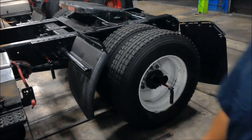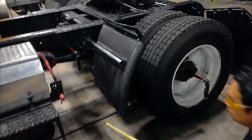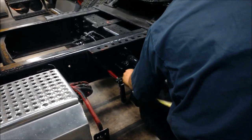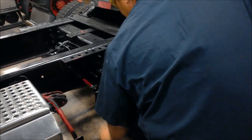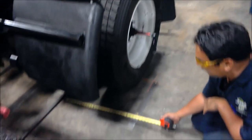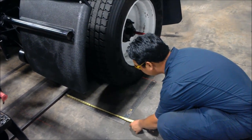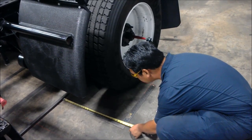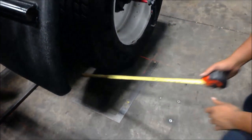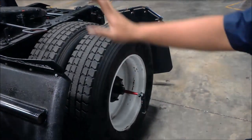I have the EZ line set up to where you can measure the offset of the wheels. I have it attached to the laser on the roof itself. I have another one on the center of the axle. That's about 25 and 3 quarters. You would want to do the same — measure the same setup on the other side of the axle.